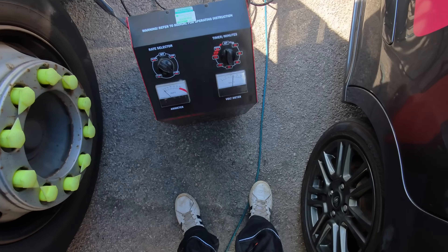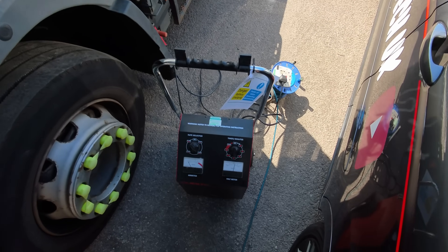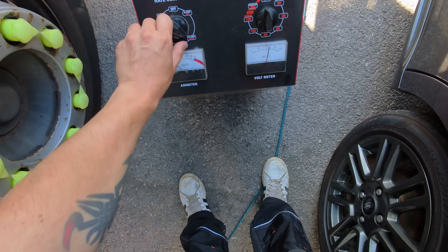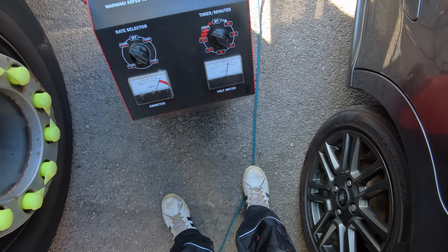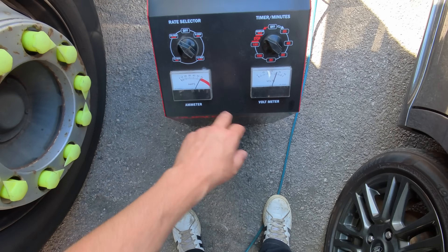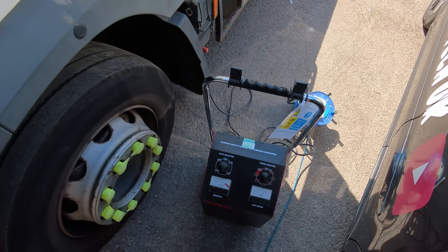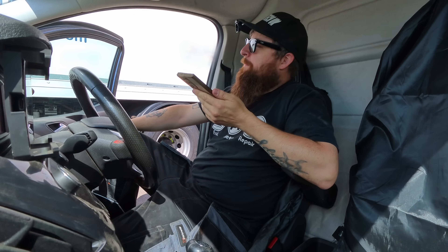In order to facilitate this exchange of information I've got the battery charger connected - a maintainer to maintain 24 volts. We'll set this to 24 volts manual and then set it to maintain. Hopefully this will give us enough amps - it certainly looks like it will - to maintain 24 volts while the programming is happening.